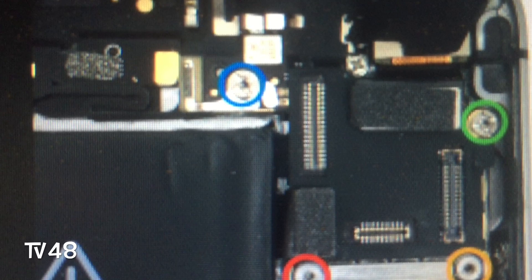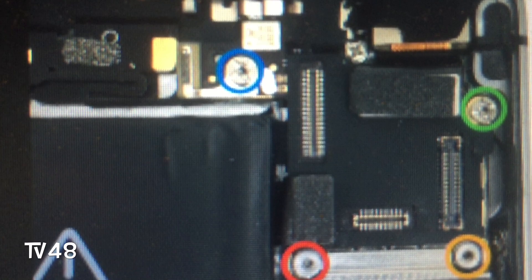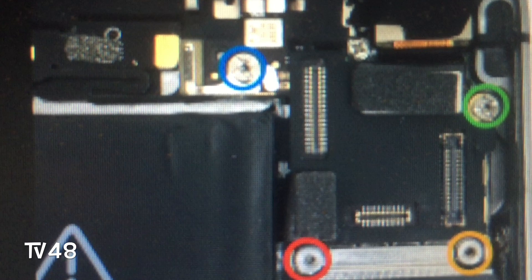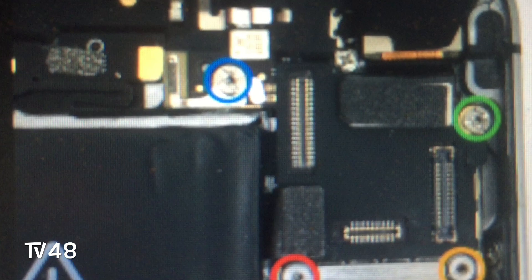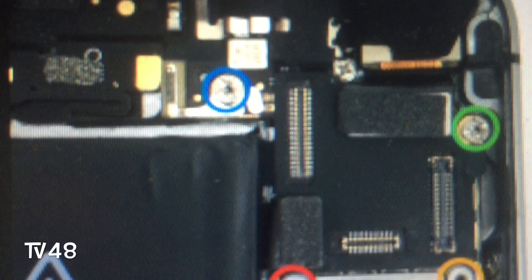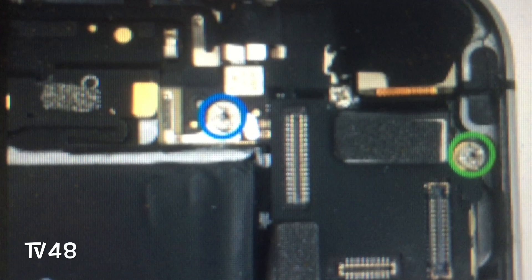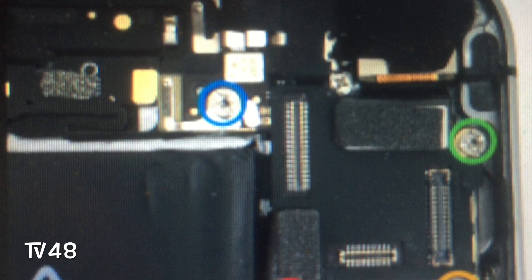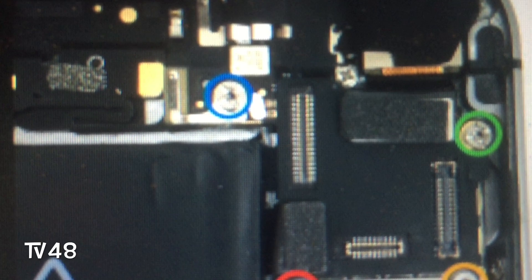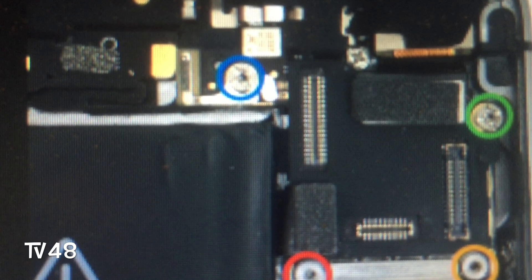As you can see, we're looking here at four screws that I've given little blue, green, yellow, and red circles. These four screws must be removed if you're going to fix your screen. The problem is that all four screws are kind of different, especially the yellow one. The yellow one is the one you should ask your phone shop — whoever is going to replace your screen — not to put back. Just fit the bracket with the three screws, and then you will be sure not to get any blue screen after the screen is fixed.